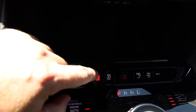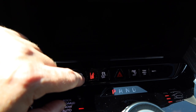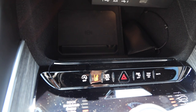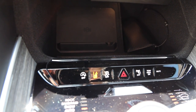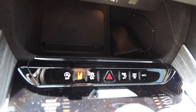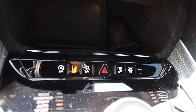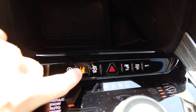Here on the same display: your auto start-stop function is right here, and next to it is your lane keep assist — I have mine off. I've seen a lot on the forums about this: if you have adaptive cruise control set and you keep your hand very still, you'll constantly get a chime telling you to keep your hands on the steering wheel. You have to jiggle the wheel a bit so it senses input. If you turn lane keep assist off, you will no longer get that chime. It's there because this is not a self-driving platform — Wagoneer wants to ensure you keep your hands on the wheel.